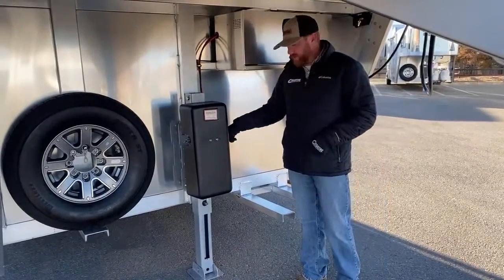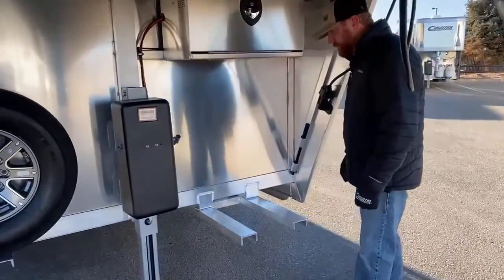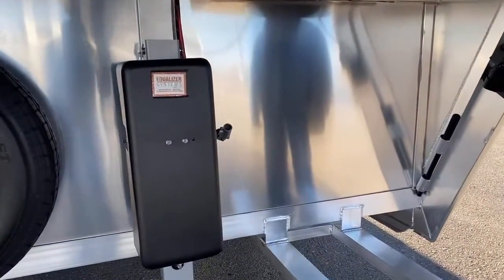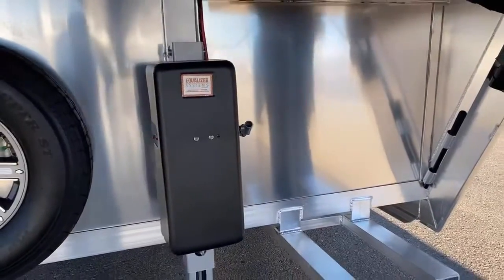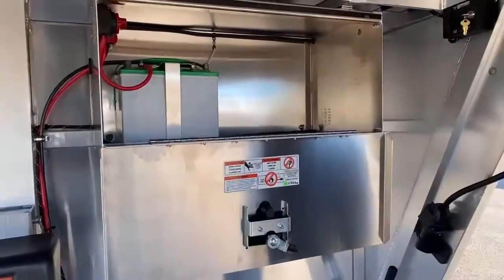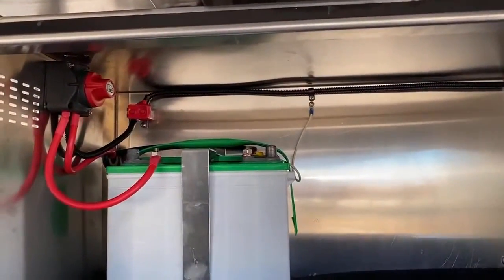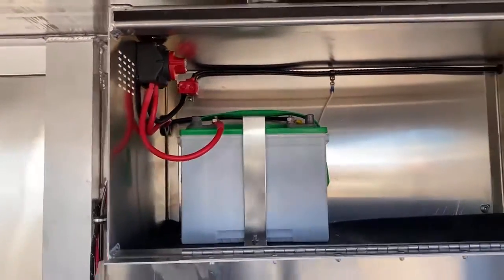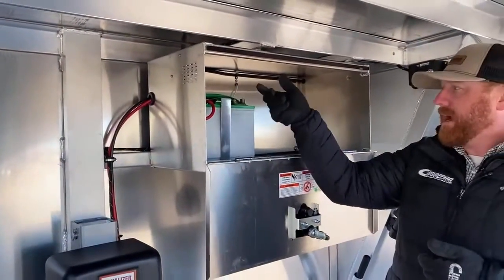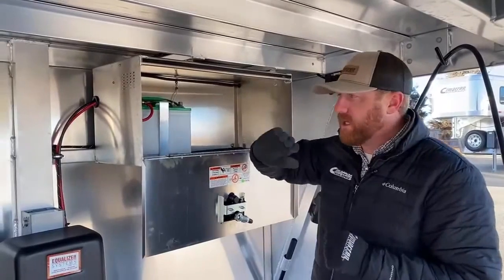If you do need to override this, it does have the manual pump as well. So if you get in an emergency situation, you can go up or down with this. We've got a battery box up here, and we also have a battery disconnect. We like adding those to our trailers if they do have that hydraulic jack, because that way if a light gets left on in this trailer, we're not draining this battery. When you go to unhook it, the last thing you do is just reach up here and turn this off — trailer's dead.